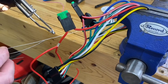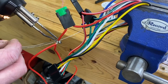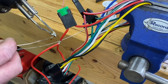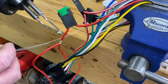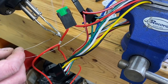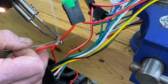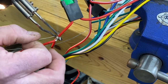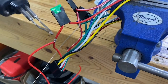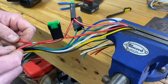I personally prefer a solder gun — I know you probably think I'm old school, which I really am, but I've been using the same type of solder gun for years. There is no wrong tool as long as it works. You're going to apply the heat on the side of the solder tip — the tip is not used to apply solder directly. Touch the wire and make contact with the side piece, and you'll see it melt solder, so you know it's hot enough. Hold it against the wire as you're feeding solder, and once it's hot enough the wire will take that solder. At that point you can release the trigger.